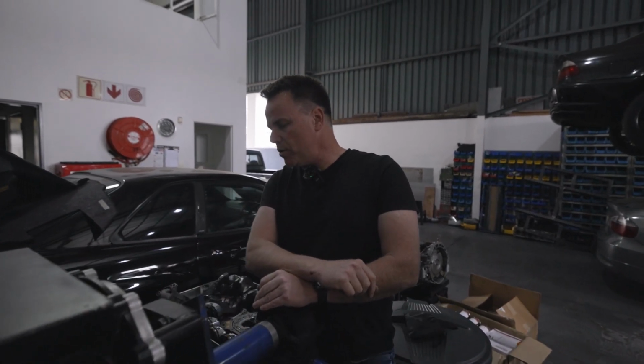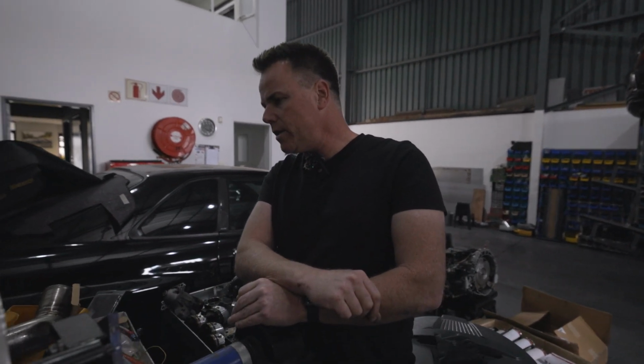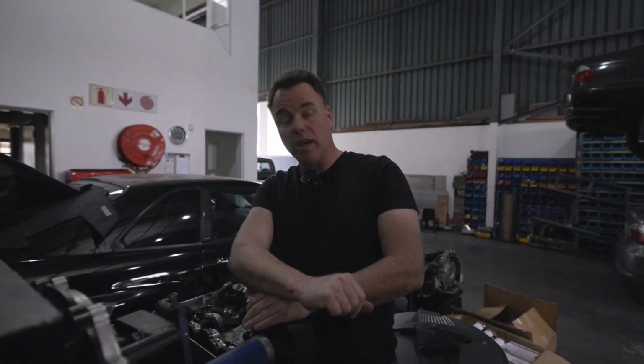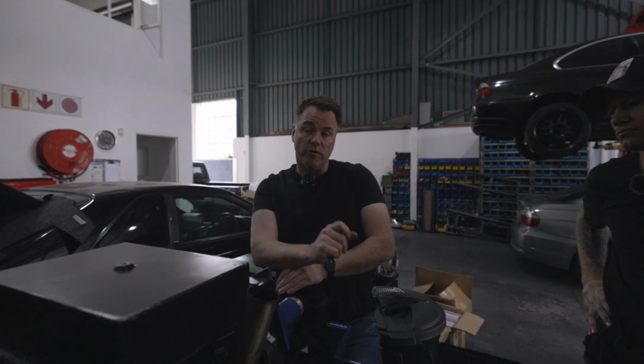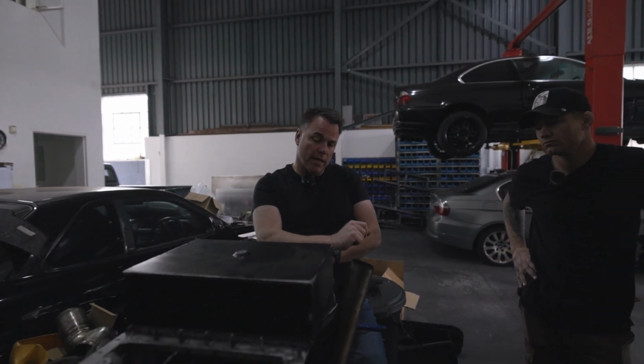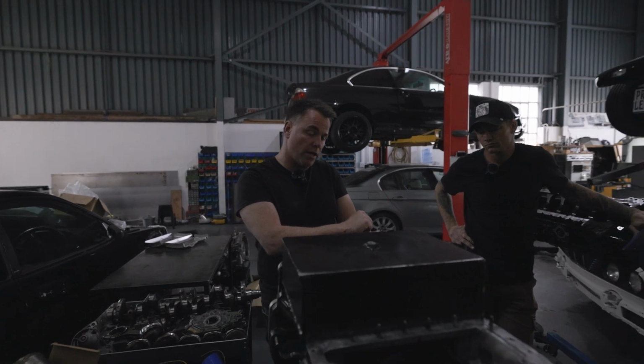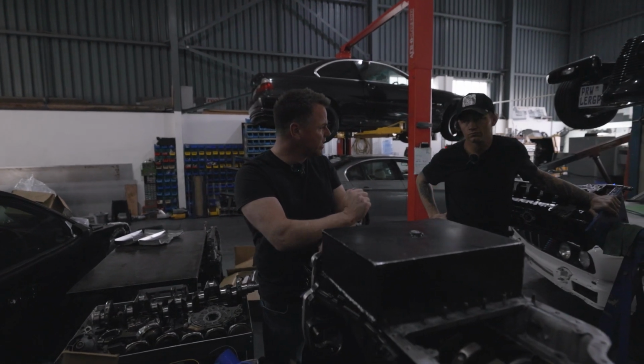Yeah. We're going through all the piping. We're making up some new radiators and the piping thereof. We're toying with the idea of moving the engine further back in the car. Martin has already taken the gearbox to a gearbox specialist and had them go through it. It was grating in second, third gear.